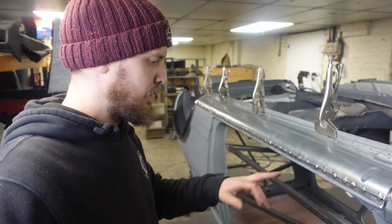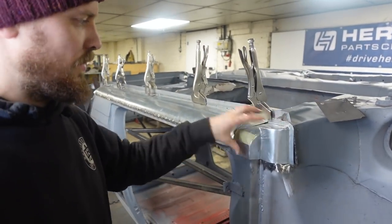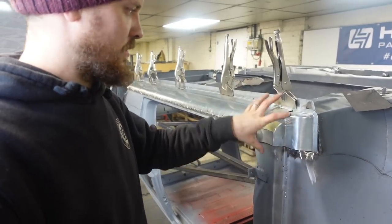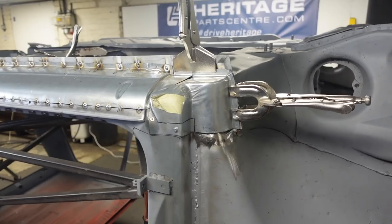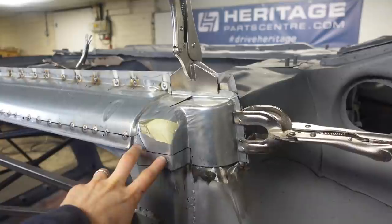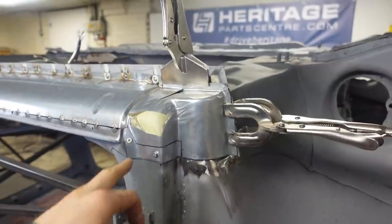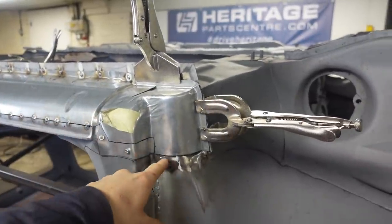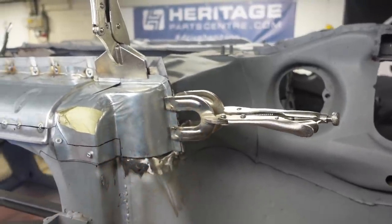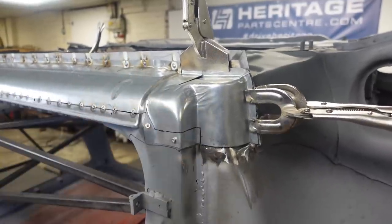We need to weld this all up now and then get this front piece on — I had to remove the front corner from the sill panel just to make it easier for getting it on and in the right place. I've just started working on this front corner: trimmed a little bit off, got it all clamped in place, a couple of screws in to hold it. I'm going to cut through on these lines here to get it to sit back in the right place, and then put some slits in this to knock it back into shape to fit this contour of the arch. Let's just get on with it — no point chatting about it.